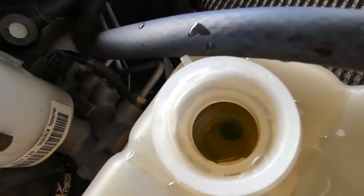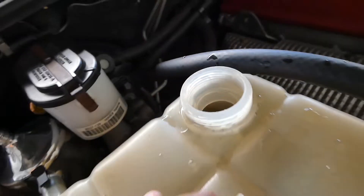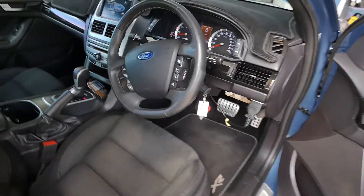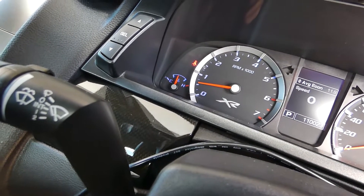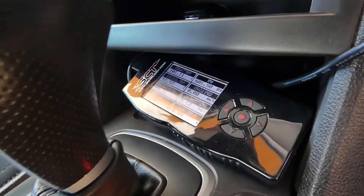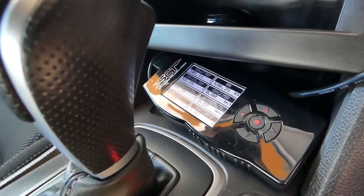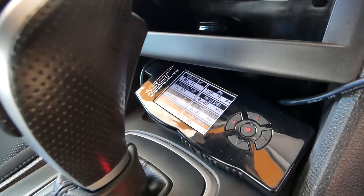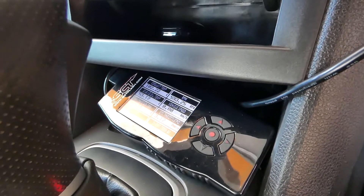As you can see in there it's gone a bit more green now, which is good. It's starting to get a bit greener — the heater core has obviously opened up now and we're starting to flush everything properly. The heat's going up as well, which is good, getting up to temperature. The cooling temp has now reached 100 degrees, the thermostat's obviously opened up now and we've reached our operating temperature. The thermo fans will kick in just to keep it a bit cooler, but that's what we want — we want it to reach temperature.